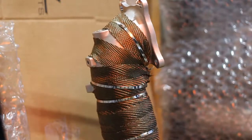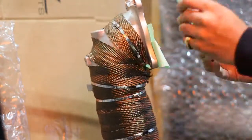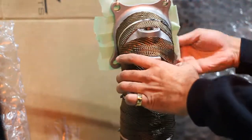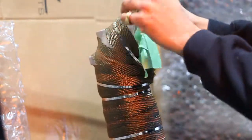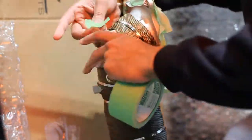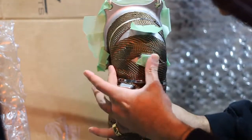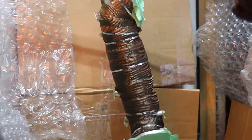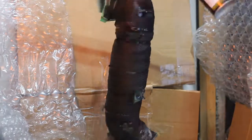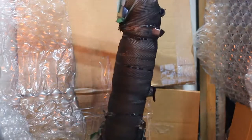Now we're in the garage and I've let the water dry up on the wrap, so that when I'm spraying the sealant it's applying onto a dry wrap and can absorb better to seal a lot better. Before I start spraying I'm going to tape off all the parts that need a bolt through them, and also the sealing surfaces on the flanges on both ends. I'm going to apply three coats of sealant onto the wrap, letting it dry about 25 minutes between each spray session so the wrap has enough time to absorb the sealant and make a good seal with no moisture going under the wrap or onto the piping.